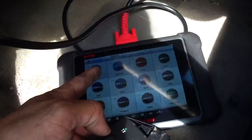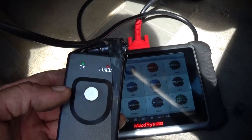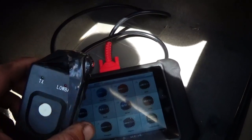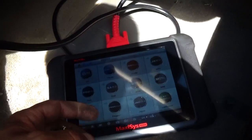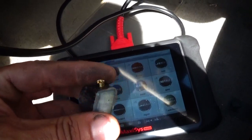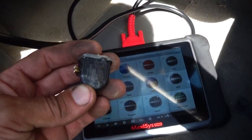Sorry to miss going through the menus. Basically you get into the menu, get the learn process started, and go around starting at the driver's side front wheel, then passenger side front wheel, then back passenger wheel, then back driver's wheel. Each one you push this button. As you can see the antenna is all damaged — it seemed like one time I was able to get it to program, but the antenna wasn't getting close enough. It timed out and I lost it. I had a heck of a time with all the wheels. This one here was the worst — I ended up taking it out of the wheel. It does work but you can't program it through the wheel.